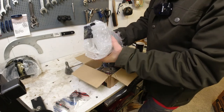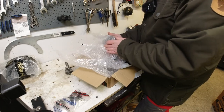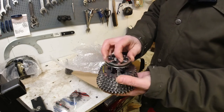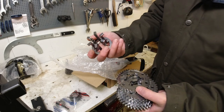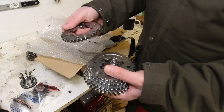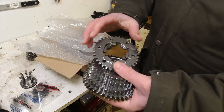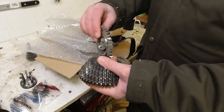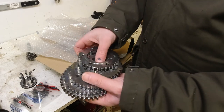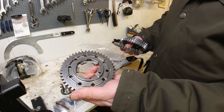These are just a work of art, and this is going to be a video by itself — I'm going to show you how to shim the five-speed gearbox. Look at this — engine bits porn! These gears have this great sort of polished look about them. What they found out is they can make the flange a little thinner so that they can make the gears themselves thicker — so these are sort of the original Innocenti thickness. And they've got these extra holes for extra lubrication.